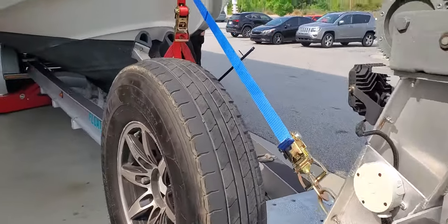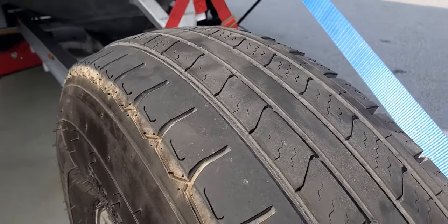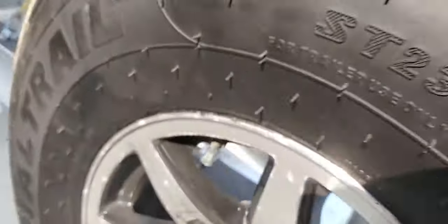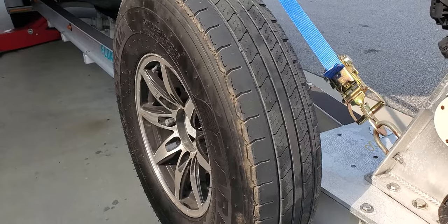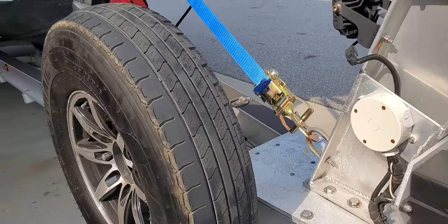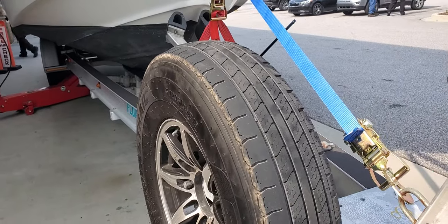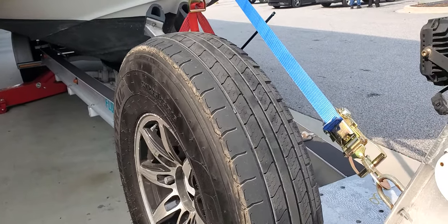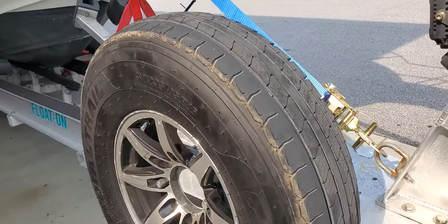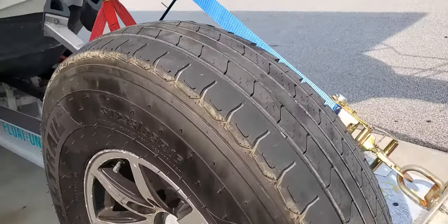Here's one of the tires I just removed. I decided to make a full video about this instead of just a quick short. This tire is date coded 1120, meaning it was manufactured in the 11th week of 2020. When I'm transporting for a customer who bought a boat online and got a survey for financing, nine times out of ten nobody's ever really looked at the trailer. Even brand new trailers with brand new tires — this one is only about a year and a half old — can have what's called a separation issue.